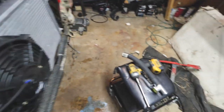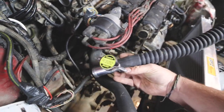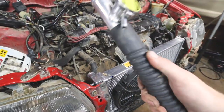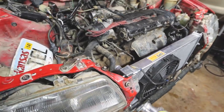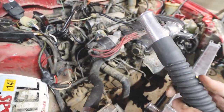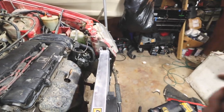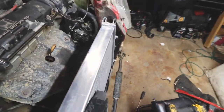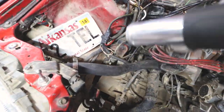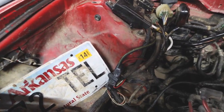The challenge with this radiator is there's no filler neck — nowhere to put fluid in — so you have to come up with a solution. An inline filler neck is what most people use. I'd like to mount it right here. The goal is your filler neck has to be the highest point on the whole system. A lot of people run an auxiliary overflow tank, which is probably a better system, but for now I'm going with this. That's why I did the battery relocation in the last video.